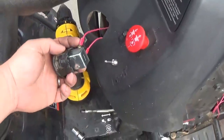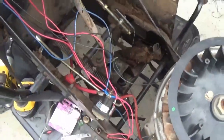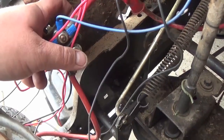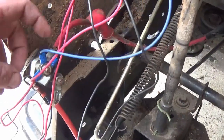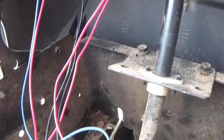Basically what I'll show you here: we've got a hot end, which is a constant 12 volts, and then you have another wire which is also — when you push this — it switches over to 12 volts and brings it over to the solenoid. We've got a cable going from the other side of the solenoid to the starter over here, and then we have 12-volt power running all the way to the back of the tractor. Everything I'm drawing power from, like the PTO switch, we've got a hot going to the PTO switch and a hot going to the push start button — that's about it on the hot wires that you need.